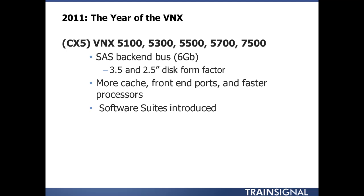The biggest changes included a SAS back-end bus. You're moving from a 4- or 8-gigabit Fibre Channel back-end bus with the CX4 to a 6-gig SAS bus. With the SAS bus, it's really four channels, so four times six — 24 gigabits of bandwidth to move data between the storage processors themselves and the back-end DAEs. It's extremely more expandable and scalable than the original Fibre Channel bus, which used basically an arbitrated loop type technology for back-end communications.